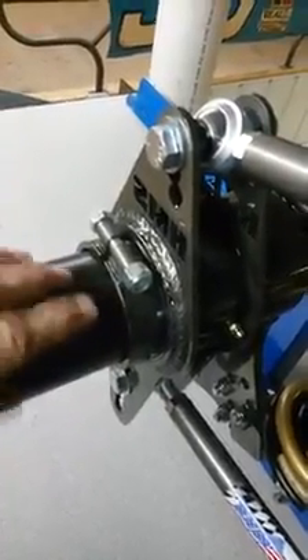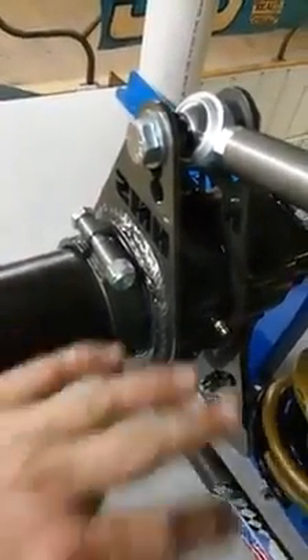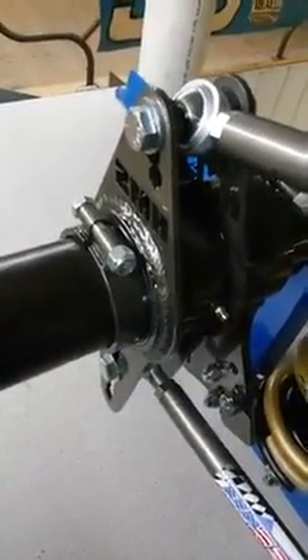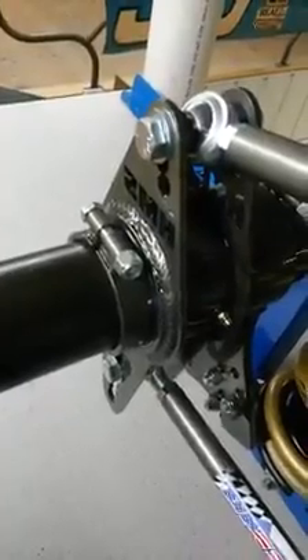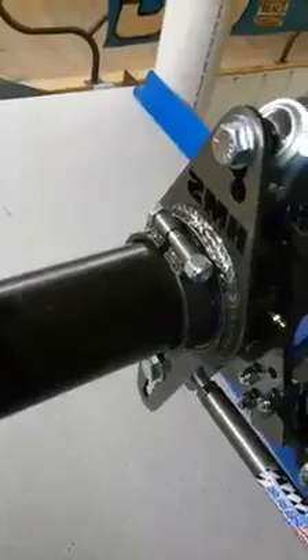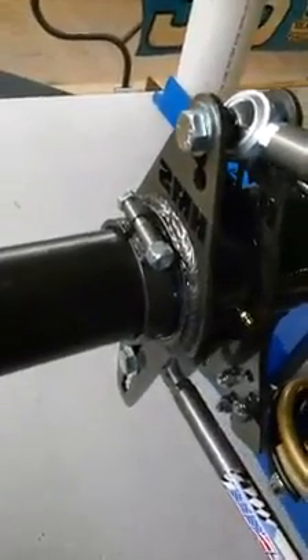When you put the grease in there, what that will do is — after you're done washing your car — shoot some grease in there, it pushes the water back out of the bearing. It'll give you bearing life. Also, when you go to pull the cage off the rear end tube, it will slide off easier because the tube is not rusted in between the two bearings.